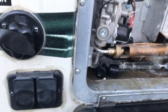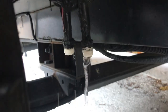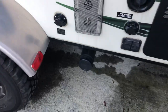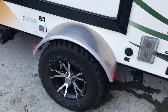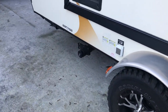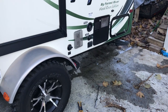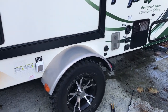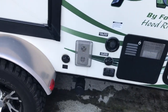Just keep them out for a day or two and then close them off so the air and water completely drain from your pipes. Also make sure you flush your black water and gray water tanks before you winterize, so the tanks are empty. You can also put some deodorizer inside the sewage, black water, and gray water tanks so they smell good inside.